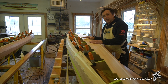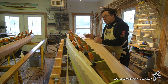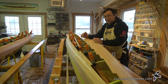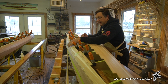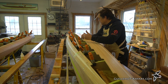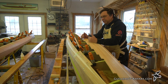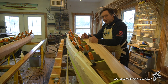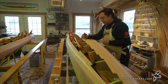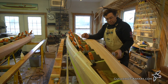We've done a lot of the over-strip and trim-back process, and I'm doing another one here on the keel line. It's a related process to what I did at the chine and at the waterline, but here we're going straight down the keel line. This is a little bit easier to envision as a straight line. All the other ones were straight lines also, but they were in sort of weird places. This is straight down the middle, and I'm going to do it a different way.